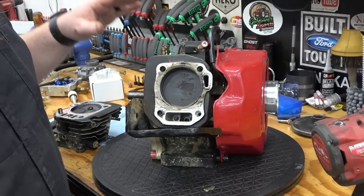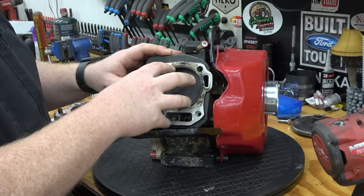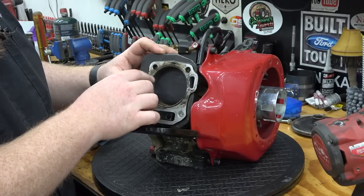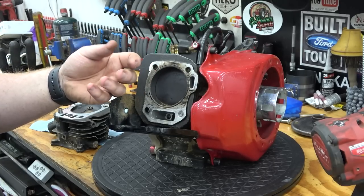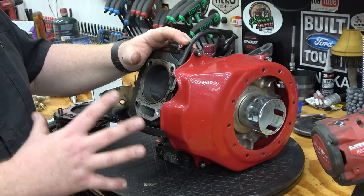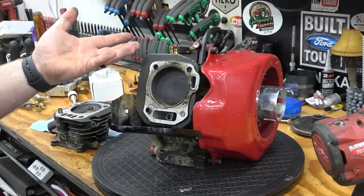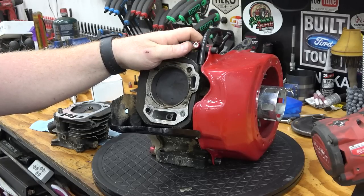After looking at this more, I'm pretty sure what is happening is the actual steel bore that's pressed into aluminum is getting shoved out of the engine. Basically, it's pushing the steel bore out, and that's what shattered the block right there. The bore started to come out of the block — don't know why. It's probably just a faulty block. We got this before it even hit shelves, so this was kind of a brand new engine — we got one of the first ones in America. That could be an issue with quality control. So we're going to tear this block completely down and go to Harbor Freight and get a brand new 224 block.